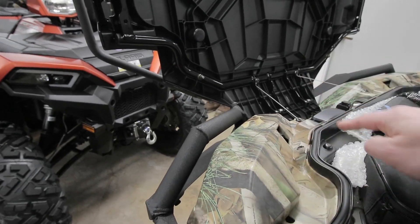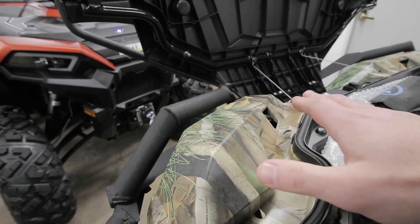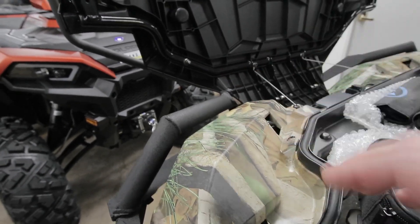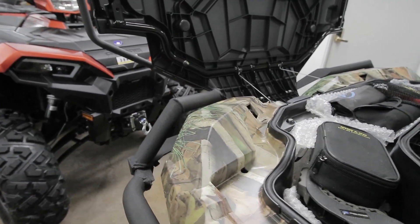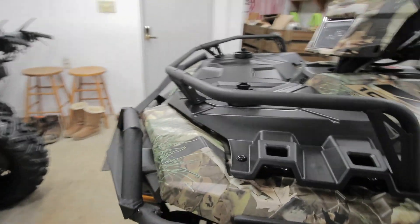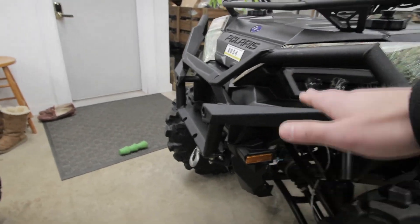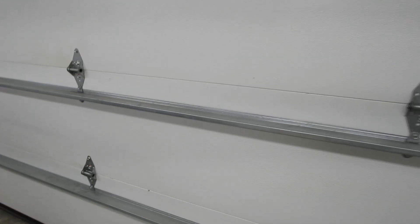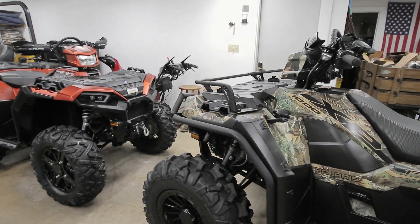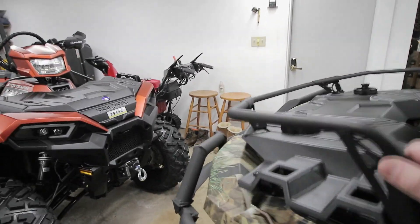These new headlights have those same screws with springs on all three points, so with this three-piece spring and screw system I may have to align the headlight in the rotation axis as well. I'll align the headlight housing against the garage door outside and measure the centerline of the projector lenses off the ground with a tape measure. Then I'll mark the same centerline on the garage door but subtract two or three inches for a downward angle, standing back about 50 feet.